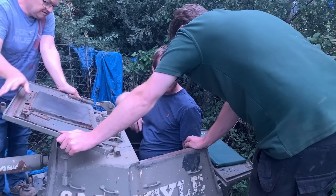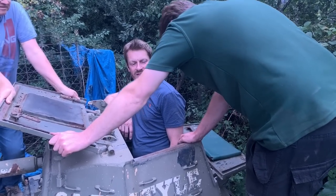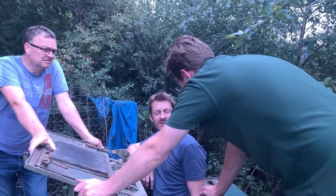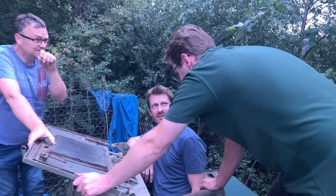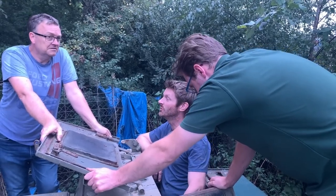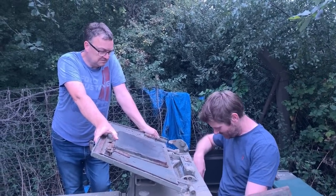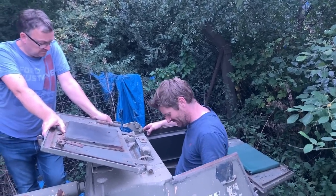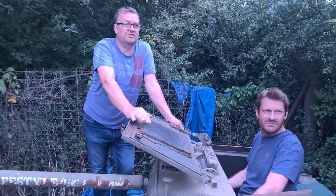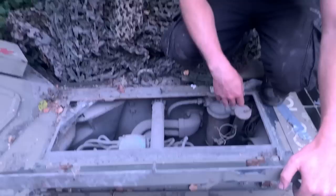It needs some oil, check the bores, check all the spark plugs, put some fresh plugs in it. I think they're normal plugs. Yeah, suppressed. The radio-suppressed plugs, so that they don't interfere with any radio gear. You haven't got a stereo in it. We got some ATF.